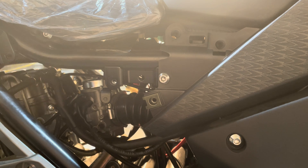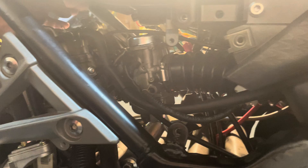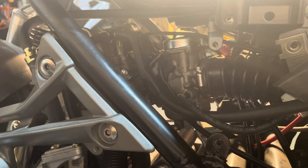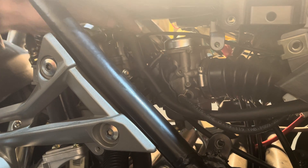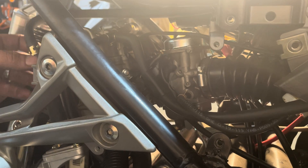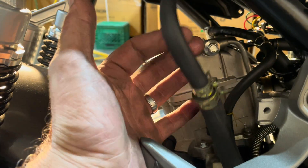These are like vacuum lines basically. One comes up to the overpressure line on your engine right here. That's the overpressure line on top of your engine — you don't want to kink that hose. That returns back to the air box. The same as this line down here — it's another line that goes down to the engine for air. It's just an air vacuum line, there's no oil that runs through this. That's the one that goes off the top of the engine and then flows to this T right here and then flows to the front, and then goes down to the crank right here too — it's just to blow off pressure.